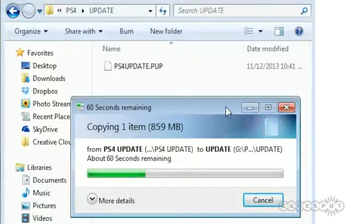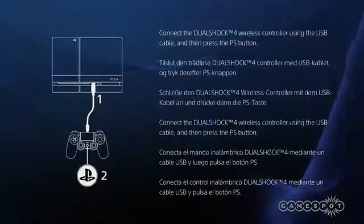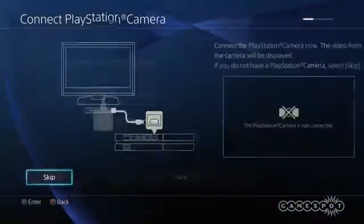You want to have a directory called PS4 in all capital letters, with a subfolder titled UPDATE also in all caps. With those folders created, copy the firmware update that you downloaded from Sony's website and insert the USB stick into the PlayStation 4. To boot up your PS4 and install the new recovery, hold down the power button for about seven seconds to enter the system safe mode. From here you'll be prompted to update the PS4 via USB storage — click X to confirm — then the PS4 will initialize and install the 1.5 system update. The whole process takes just about five minutes.